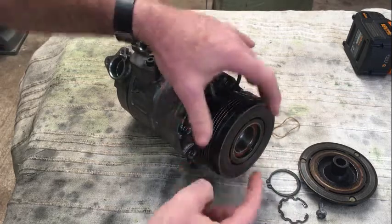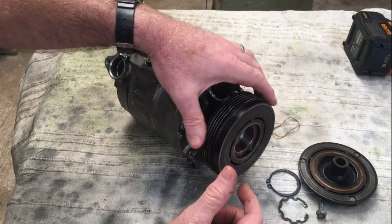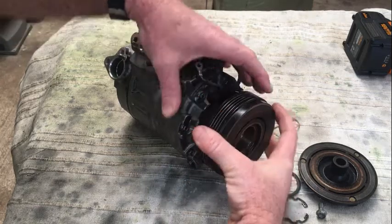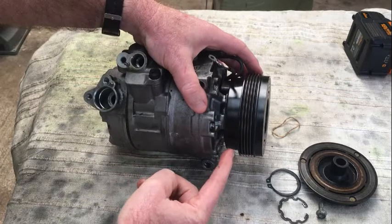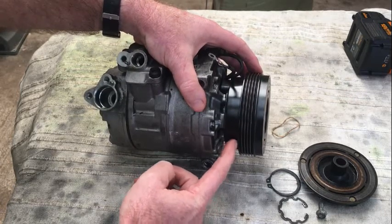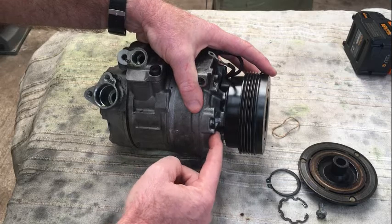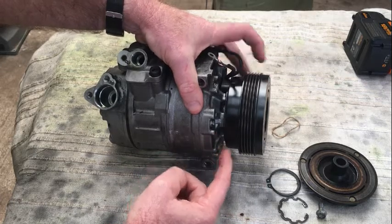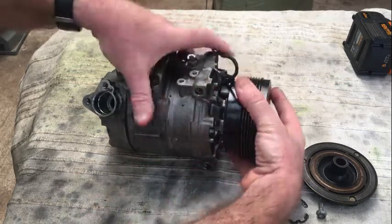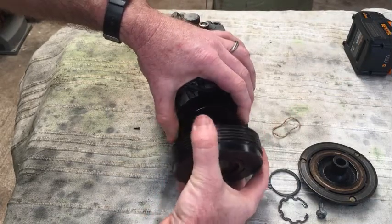If you're actually removing this while it's in the car — because this is the bearing which sometimes needs replacing — and you want to be able to remove it without disconnecting the whole air conditioning system, the back of the pulley only goes in about 7 or 8mm before it gets to the magnet at the back. You don't want to try and lever from behind the magnet — that could break it. Just work it either side to wiggle it off. It's a bit of a pain but it can be done. Certainly when it's out of the car it's dead simple using a three-arm puller.